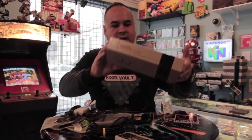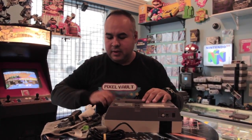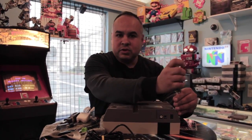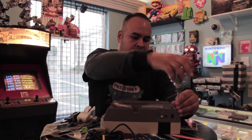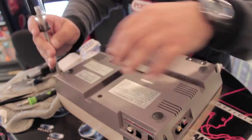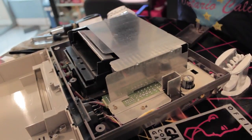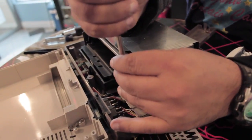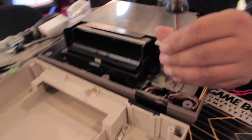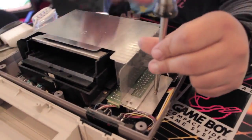You don't need to buy a new 72-pin or anything — I'll show you guys. First thing, flip the Nintendo over. Take this tab off, and from the bottom get the screwdriver. There are six screws you have to worry about, so get all the screws loosened up. Now that we got the top part off, get all these screws out. Note where they're all at because of this heat shield.